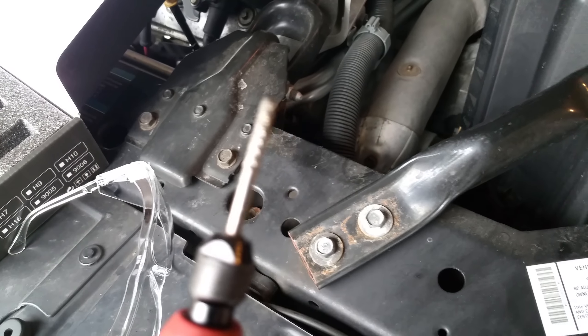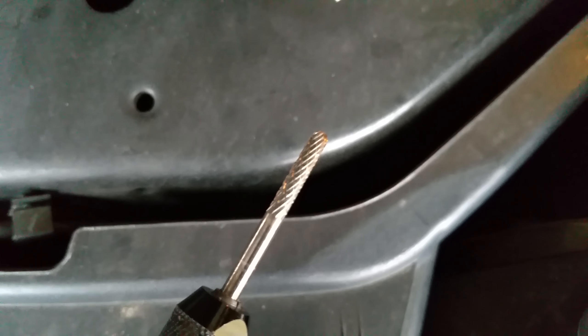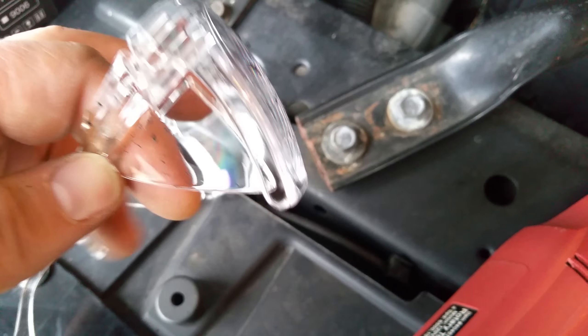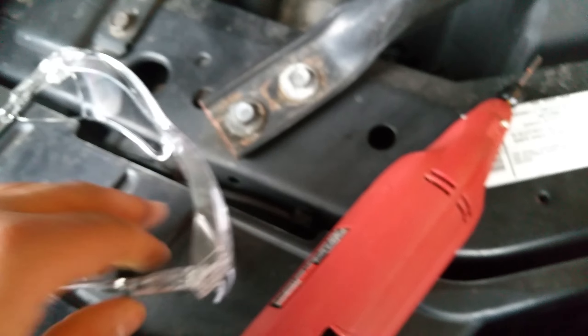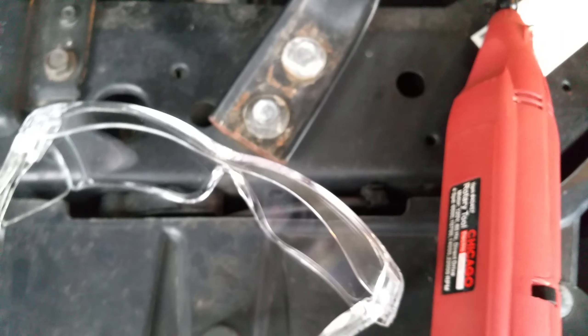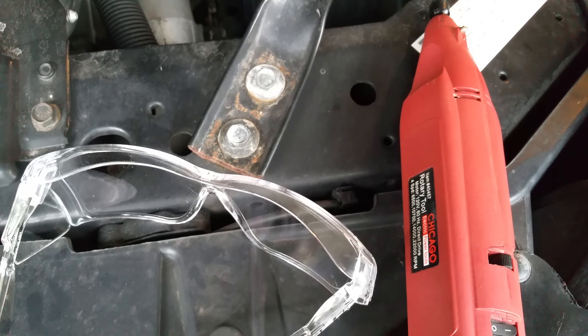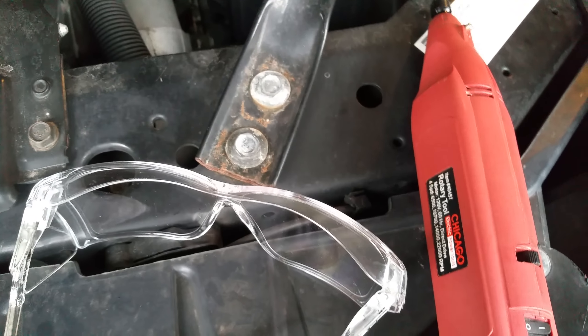I want to make sure not much water, snow, or anything else gets up underneath. For the actual drilling I'm using a Dremel with a standard jagged-type bit to cut through the plastic. Safety goggles are required because there are going to be a lot of plastic shavings coming down — you definitely don't want those in your eyes. It's best to come at this from the side rather than directly underneath so hopefully you won't get debris in your nose and mouth. Just be aware of the mess it's going to make.